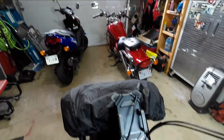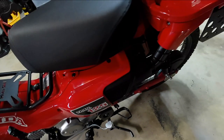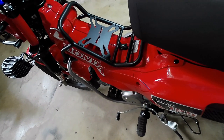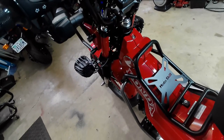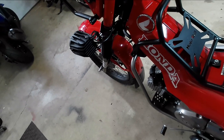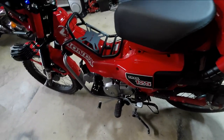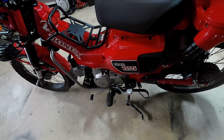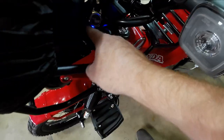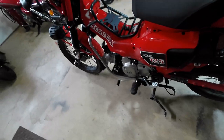The fog lights look great. The USB setup is connected downstream of the battery, wired into the battery tender plug. I have it wired on this side of the battery because I can see what's coming into the bike when I plug in the battery tender — it was really important for me to see the charge coming in and the battery voltage both when it's off and when it's running. It has a power switch and it's waterproof — I like it a lot.